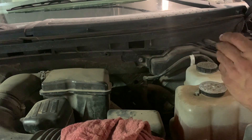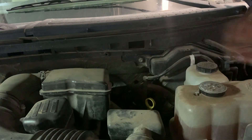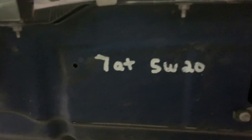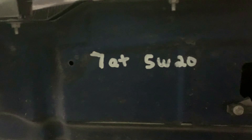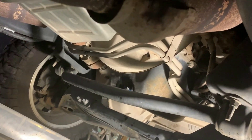It takes seven quarts. Something you can do — it's kind of tacky but no one's going to see it — you can write on a sticker the number of quarts and the oil type. I put seven quarts, 5W-20, and we used Mobil 1 — that's what the customer wanted. Use your preference, unless it actually specifies a specific oil, in which case use that oil. Also, while the car was running we came down and looked at the plug — it's dry, no leaking, so we're good down here.